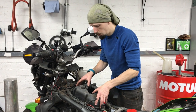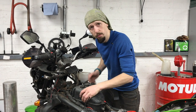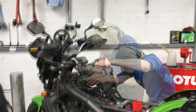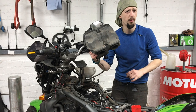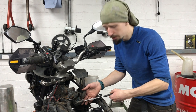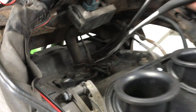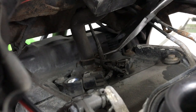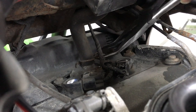I think we should be able to withdraw the airbox at this point, but I'm just guessing — so we'll see what's still attached if it wants to come out. There we are. Looks like the brain of the bike almost. Okay, this is the secondary air valve or emissions stuff, so we'll just remove that. We'll probably put it in the bin but keep it for safeness. There's a little clip down the bottom there — if you've got spindly long fingers you can get to it, but you can wriggle about with these long pliers.